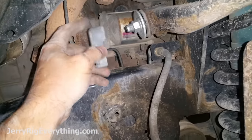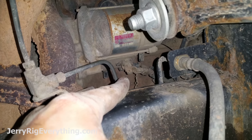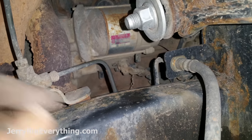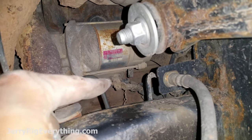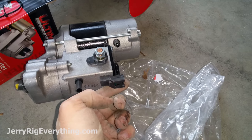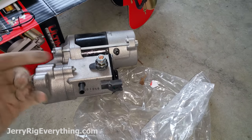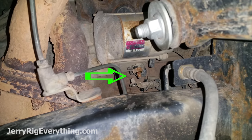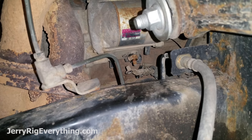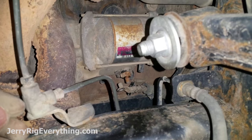Now that that's done, I've already popped off this little plastic piece — it was sitting just like this up underneath the starter on that little bolt right there, which is a 14mm. I'm going to unscrew that and pop off that connection from the starter. There's one more connection on the other side that you can barely see — it just plugs right into this little plastic connection on the starter, so I'm going to undo that as well. That gets rid of all the electrical components and allows me to pull it out from the transmission. Got that nut off and the little wire just pops down. The plastic connection is popped off the starter.